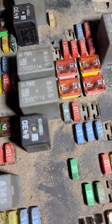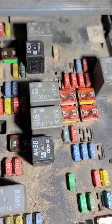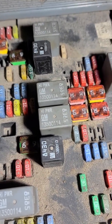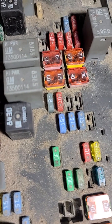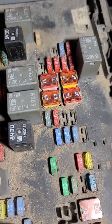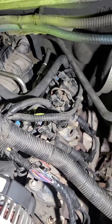I just spent a few days running around this whole truck looking for a ground issue when that was it. My symptoms were no crank, an engine light on, and a lock or anti-theft light on. It would not crank from the key — it would crank at the solenoid if I jumped it, but I was not getting power to the ignition. Hopefully this saves someone else the trouble of going through the whole wiring harness and replacing all the grounds and wondering why it's not working.